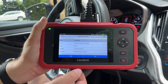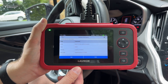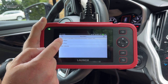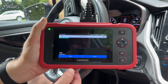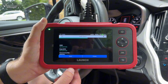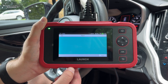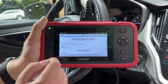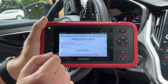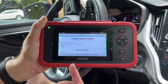We have to do an area select, so North America. Here's our year, make, model — let's go ahead and click yes. We want to make sure it's Outback, and I'm just going to dive right into it. We're going to do a health report. This is looking at every single computer in the car and giving you a top to bottom view of what's going on with everything it can see. Here's our diagnostic report, and this is definitely geared towards a shop owner. If you're turning cars in and out of the bays all day and you want to send this to a customer, you click the share button and share it as a PDF or in an email.